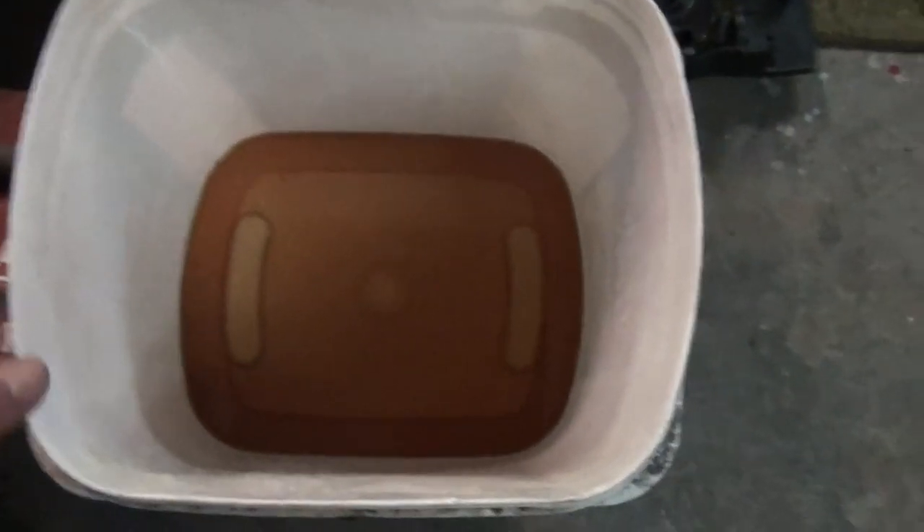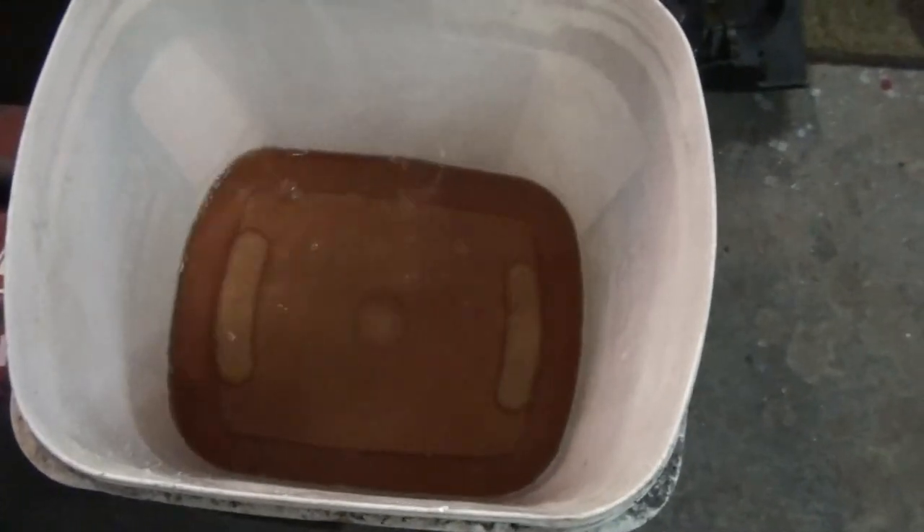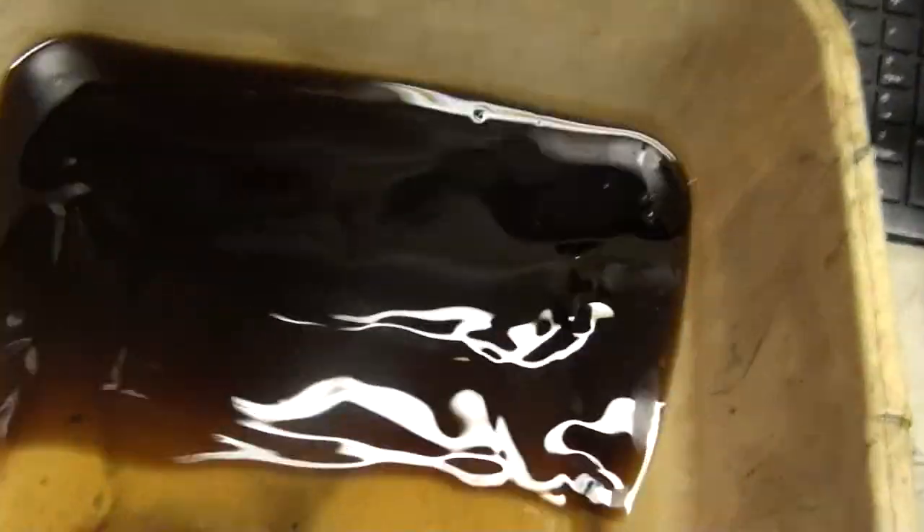After draining the gas tank — that's just a little bit more than six months old supposedly — unbelievable. Here's the oil from the snow thrower: it's pretty dirty, not the dirtiest I've seen, but it's super thin and smells like gas too, so I'm pretty sure there's some gas in there. You can see a lot of debris — there are little chunks of something in here. We're getting there.